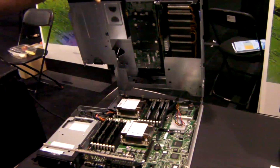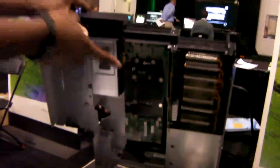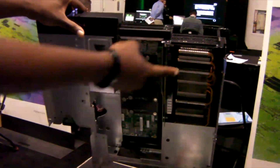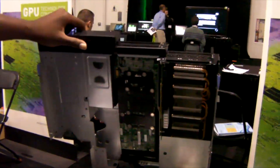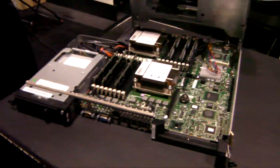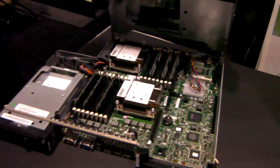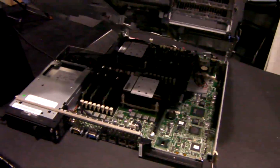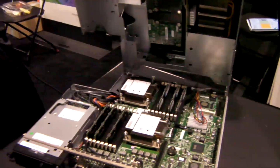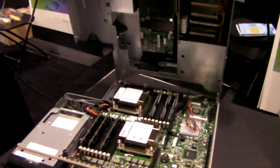Right here we have the GPU sitting underneath there. The versions currently available are the 1060 GPU and the 2050 GPU from NVIDIA — two GPUs per 2U node. You still have your two Westmere processors, 16 memory banks, and up to four 2.5-inch drives — solid-state, SAS, or SATA.